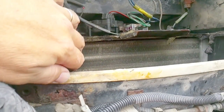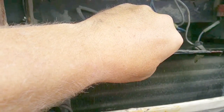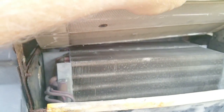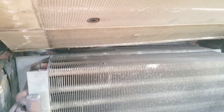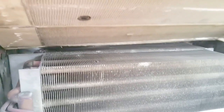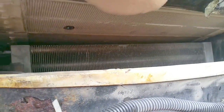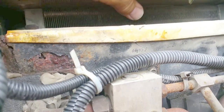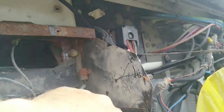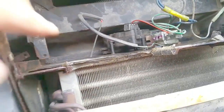The first coil is for the air conditioner, and then behind it — which is interesting — you've got this tray that you can kind of slide out and get to everything. The rear coil for the heating system is back there. A lot of the gasket material has failed over the years; it's kind of dirty and nasty. So I'll disconnect all this, clean it all out, throw some paint on the rusty areas. It is interesting how it's engineered so that this tray can come out for easy cleaning.